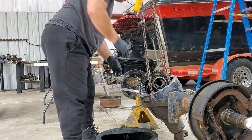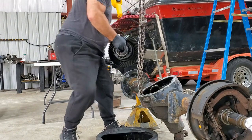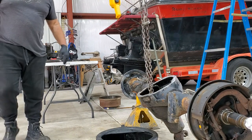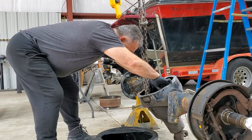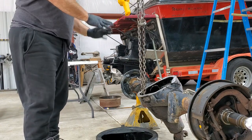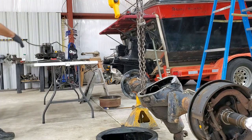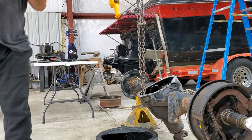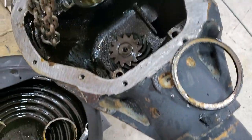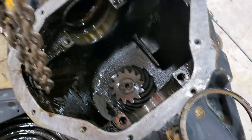I want to keep the shims the same and basically just weigh this sucker. Survey says: 65 pounds! The shims are right here. I'm going to measure them, write it down, and keep them located to the same side. The kit did come with new shims, but I'll be setting this all back up. There's our pinion — looks like they machined single shims. I'm going to measure and see what they are.